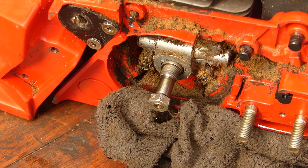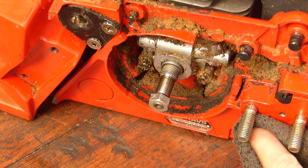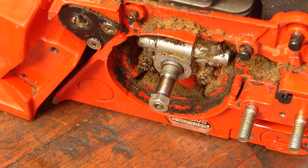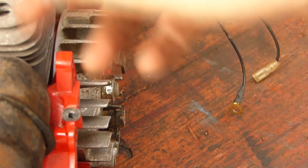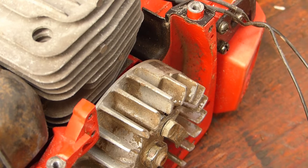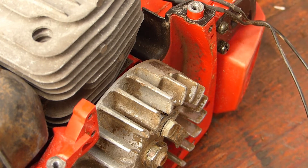Now it's just going to be completely taken apart, cleaning it up, putting it in a box, and then selling those parts. Already disconnected those — next is the exhaust, then remove the cylinder. First remove the flywheel before removing the cylinder. Then remove the AV mounts so we can remove the fuel tank and handle housing. The crankcase is separate — split that into two, then clean, and we're done.